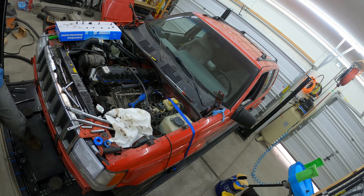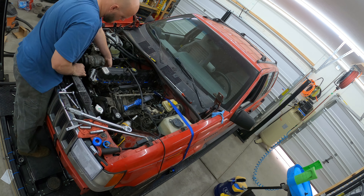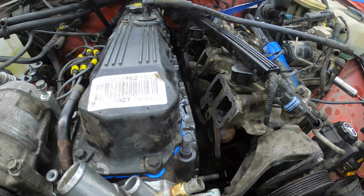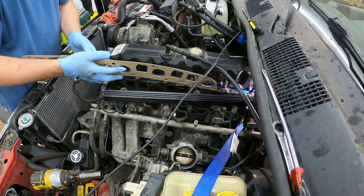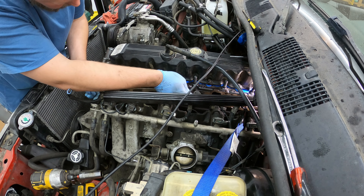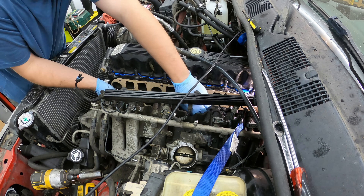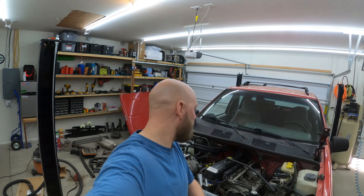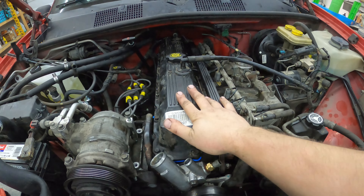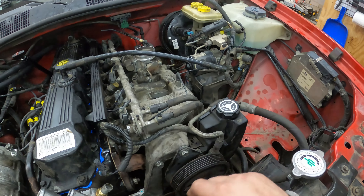We've got the cover on. Every single bolt I'm pulling out to put back in, I'm cleaning with some brake cleaner just to get the grime off. We're putting our compressor bracket back onto the head. Now I'm going to clean up the intake manifold and exhaust manifold as best I can. I'm putting the new gasket in here as well — there are a couple of studs it can line up onto. You'll put your exhaust manifold back on first because they'll land on the same studs, and your intake will be second.